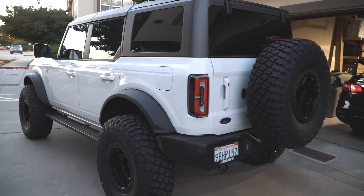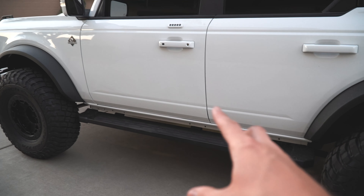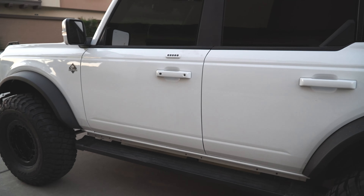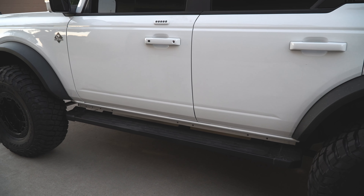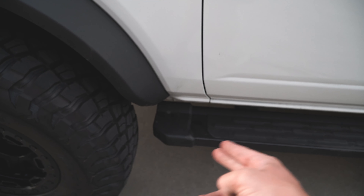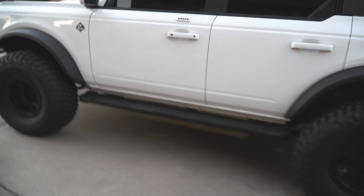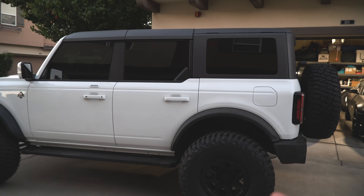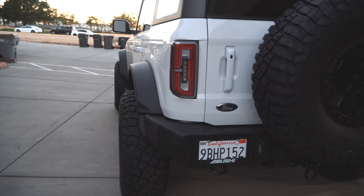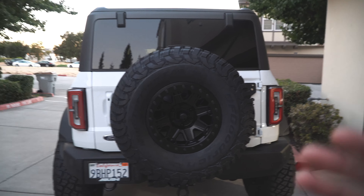The Yeti Bronco is coming all together — wheels and tires are on. I do eventually want to change out these sidesteps for actual sliders that can support the vehicle if I hit rocks. I might get some locally fabbed here in Sacramento. Because I'm currently rubbing on these, a common fix is to remove the cap, slice off a little bit of the sidestep, and reinstall the cap. The 17s and 37s are such a good look on the Bronco — beadlocks, a little offset poke — just looks nice and aggressive.